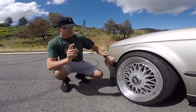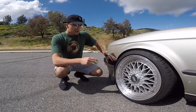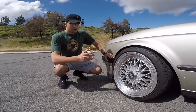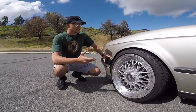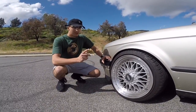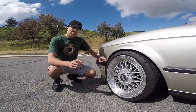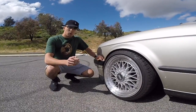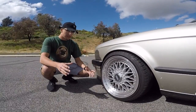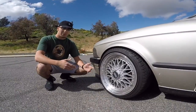The first mod, which I think is the best one, is replacing the control arms and bushings — basically the whole front suspension. These cars are 25 years old and up, so it's really important. If you go on ca2.com they have a whole kit for around $300. It's not that hard to do — you can look up videos on YouTube to learn how.